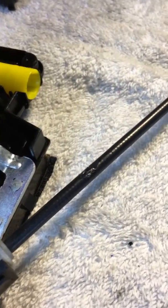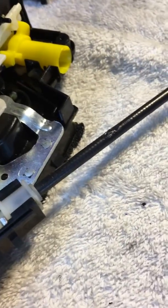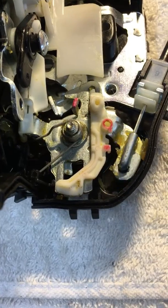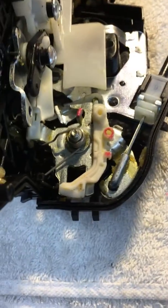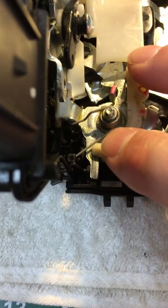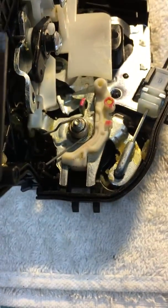Basically, the spring keeps this piece in the up position, which allows when you rotate the mechanism it allows the entire mechanism to open the door. But what you'll see is when the spring breaks, gravity allows this detail here to drop down. In that little open square you can see the arm that comes through - this would be the locked position and the door will not work. When the spring was in place and working correctly, that piece would be in the up position and the entire assembly would rotate.